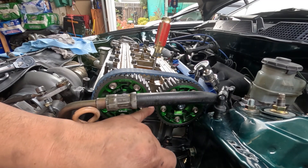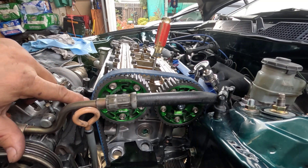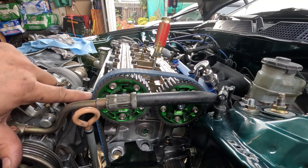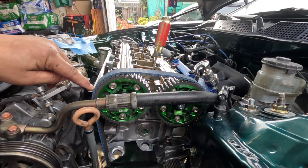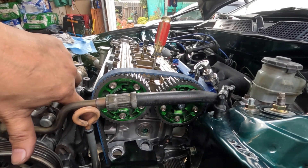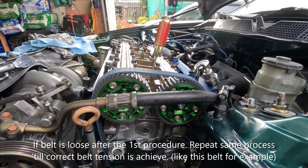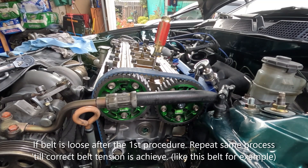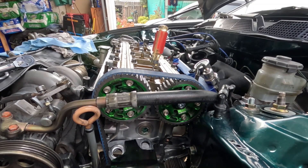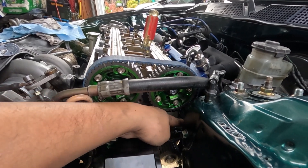Once your alignment of your cam gears are all good, along with the crankshaft, I'm gonna move three teeth. I'm going to turn the crankshaft about three teeth — one, two, three. I'm gonna line this up, aligned to the flat side of the cylinder head. It's okay if you passed it, it doesn't have to be perfect — you just want to get rid of the slack here on top. That's one, two, three teeth right there. As you can see, this side is tight, this one flexes.